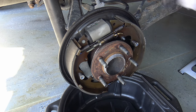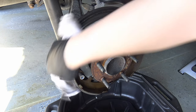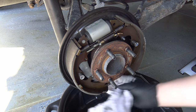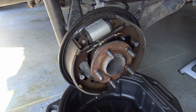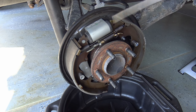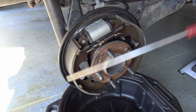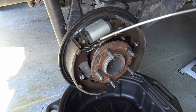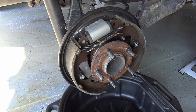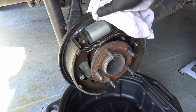While it's still wet, preferably start wiping things down and get the bulk of it off. I also use compressed air, and you can see there's really no dust coming off — that shows how well the brake cleaner cleans it. Makes it a lot safer to work on.